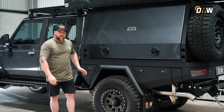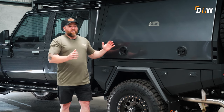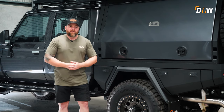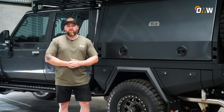So with four and a half ton GVM, you get all the chassis stiffness, you get the track correction, and the 300 extension. I can't stress enough — it just makes the car drive so well. If I wasn't wheeling hard tracks in that silver 79, I would have the chassis extension in it because it just drives so much better down the road.